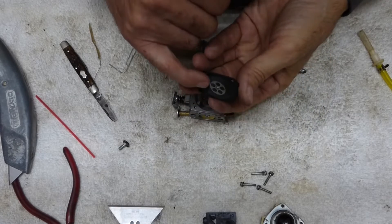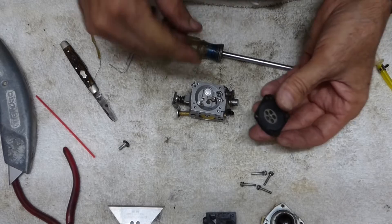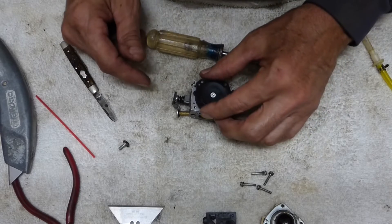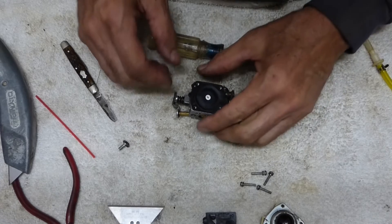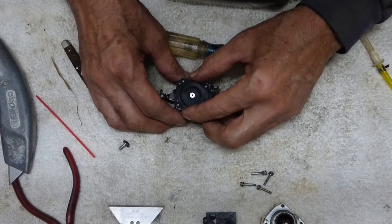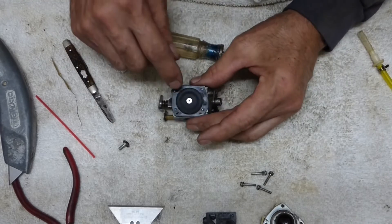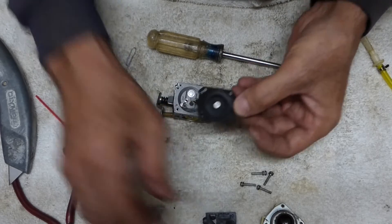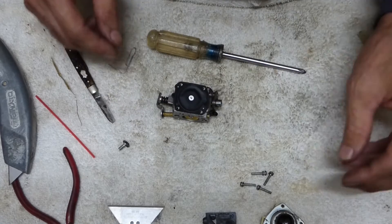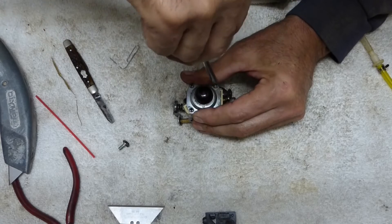Now when you put the diaphragm back on, there's a little nub right in the middle and that nub is what pushes that little pin — pushing your needle open and closed, which allows more or less gas in. So you want to make sure to get that lined up right; you don't want to put that in upside down. Usually there are little guide pins to make sure you line everything up right. It's kind of self-explanatory, but you can get it wrong so be careful. Nice and flexible — you want to make sure if you pull yours off, it's not stiff as cardboard, otherwise it's not going to operate your carburetor properly. Get these nice and snug — you don't want any air leaks in your carburetor.